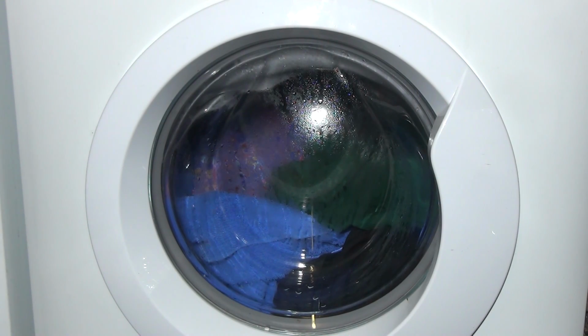Right, so during the first few minutes of washing, the machine actually detects the load, and then after several minutes will recalculate how long the cycle length should be, will reduce the wash time, and either increase the water level or basically keep it the same. So it uses a low water level first, and then we'll add more on later on if it needs to.